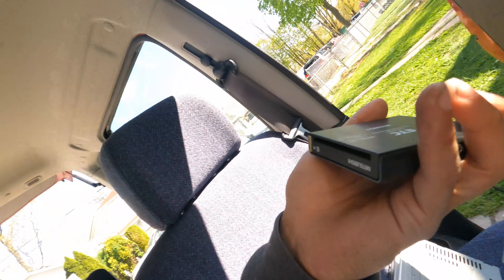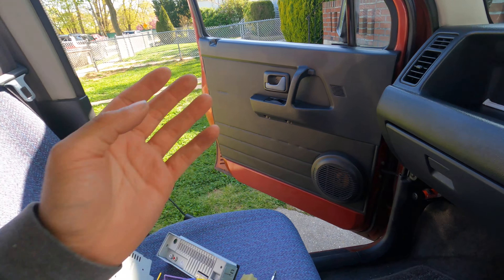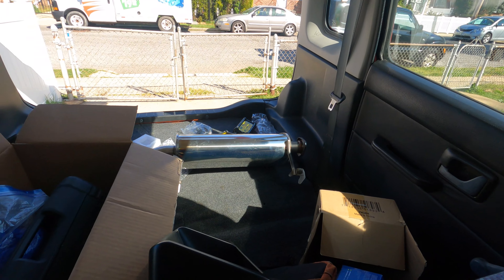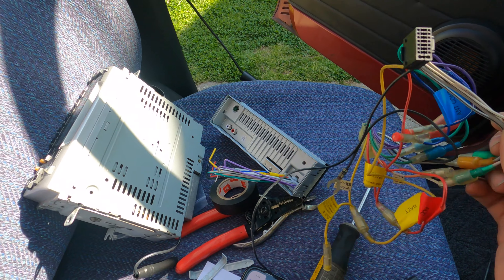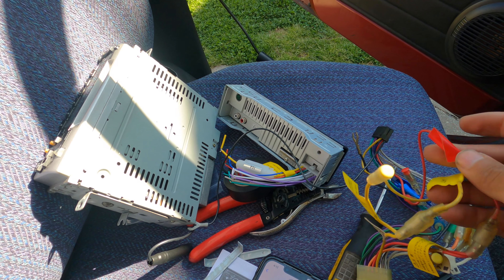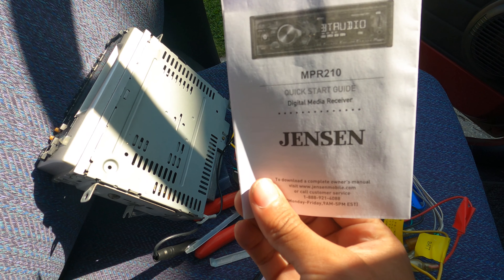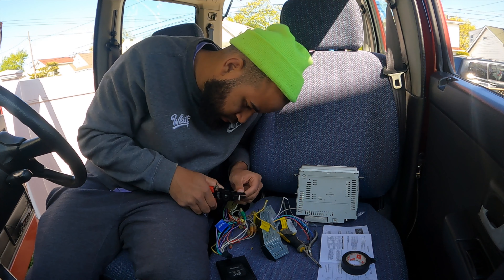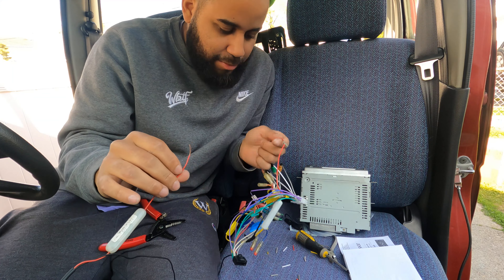While I'm doing this I also want to connect the ETC reader, so this is going to be a very action-packed video. The car is going to go from having no radio to having an ETC reader that announces in Japanese every time I turn the car on, plus a new radio and a new exhaust. Yellow is the constant power, red is the accessory switch — just match up all the colors and read the instructions. This is the Jensen NPR-210, by the way.